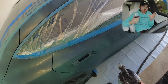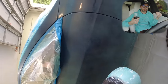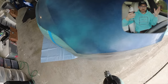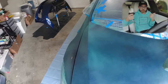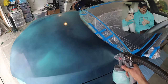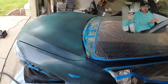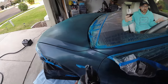I'm not going to speed this up because I struggled to find a video that actually showed detailed steps rather than just talking about it. I'm a very visual person, so I thought it's important to present the exact way I did it. Take one body panel at a time - don't jump from door to hood and back. Find a system and follow it all around the car. Do one coat and move on - do not do a second layer on spots you've already covered. This paint is plastic dip, which is latex-based rubber paint and works in unique ways.